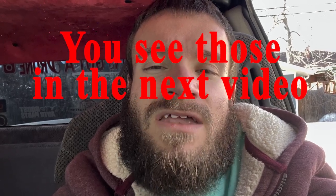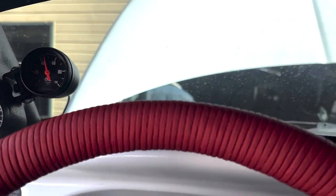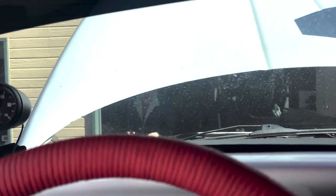Now we got the front end on jack stands, and I'm going to sit here and turn lock to lock while little brother there keeps an eye on the fluid level under the hood. This could take a couple minutes, or it could take you a good hour, so just be prepared and have some patience and plenty of fluid on hand. Go lock to lock, and eventually you'll run out of air and your fluid level will level out.